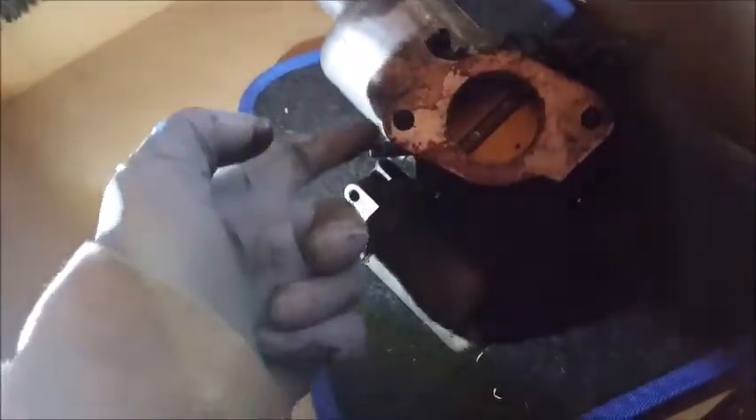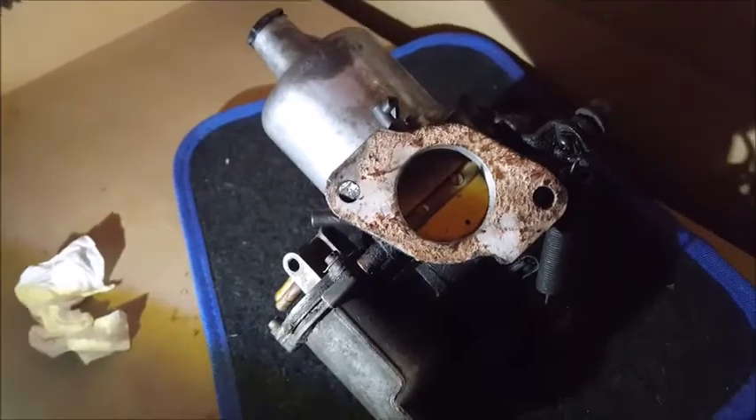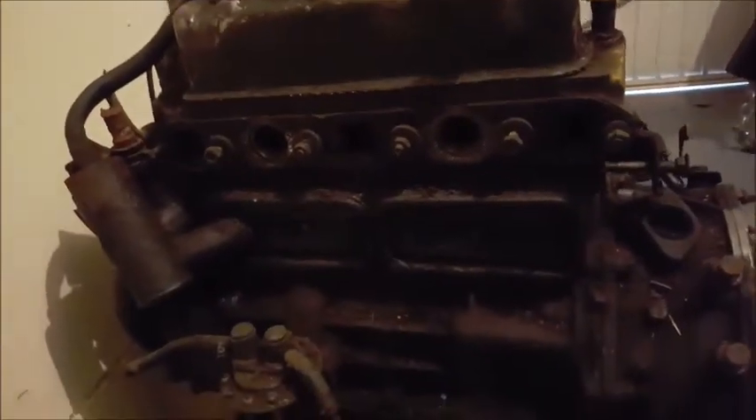That just left the two bolts that bolt on the back of these two holes here to come off and to lift this off, which is how it describes it in the Haynes manual. However, in practice, I've done this and tried to lift it out, but the top end of the carburetor actually catches on the bulkhead and the scuttle panel, so it wouldn't come out. So what I did was just take off the actual manifold from the back of the engine — that's 1, 2, 3, 4, 5, 6 bolts. Take that off and the whole assembly lifts out and up this way. Once the carburetor is detached from the manifold, you can see there's a mounting bracket that goes over the two bolts which holds on the cables. That simply just lifts off — keep that somewhere safe, I'll need to put it back on at a later date.